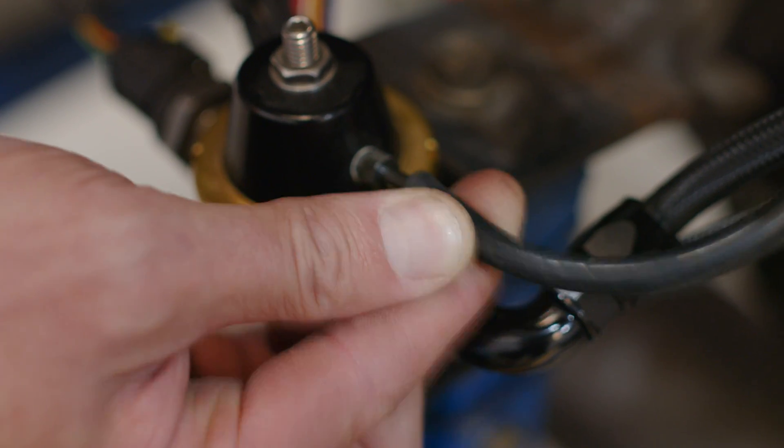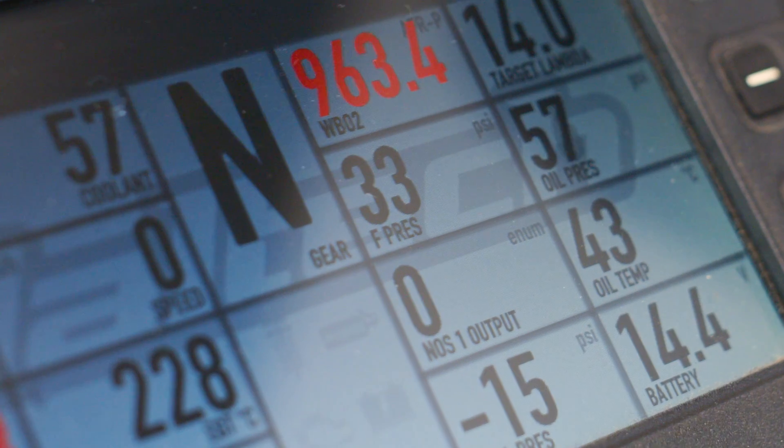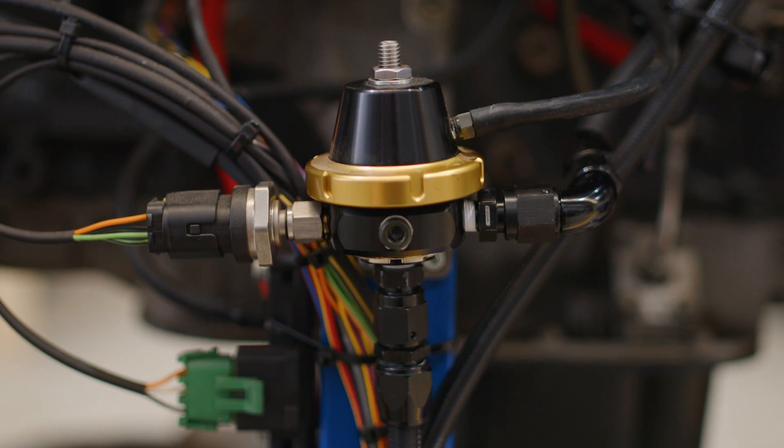Once that's done, we're on to setting the base fuel pressure. To do this, we get the engine up and running, then remove the vacuum line from the fuel pressure regulator. Whatever the fuel pressure is with the vacuum line disconnected but the fuel pump running is the base fuel pressure — commonly somewhere between about 45 psi and 55 psi. Once we confirm the fuel pressure is good, we reattach the vacuum hose, which will result in the fuel pressure dropping while the engine is in vacuum — normally about 7 psi — but increasing when the engine comes into boost, maintaining the pressure across the injector based on intake manifold pressure. This is known as a vacuum-referenced fuel pressure regulator, typically sold as a one-to-one ratio, meaning if we put 10 psi of boost into the inlet manifold and into the regulator vacuum port, the fuel line pressure will also increase by 10 psi.